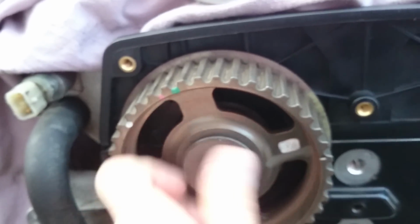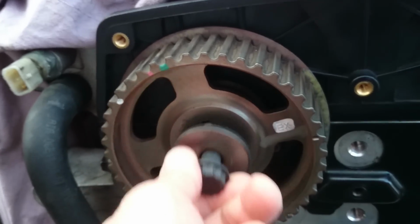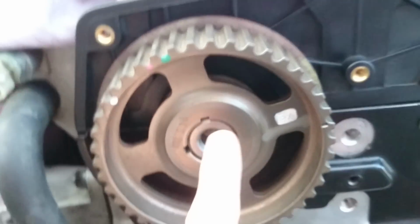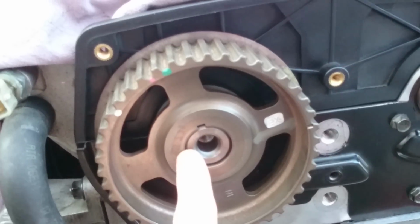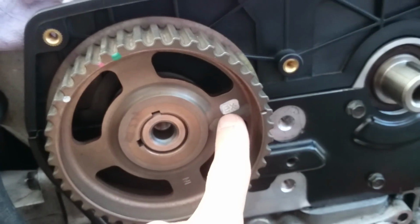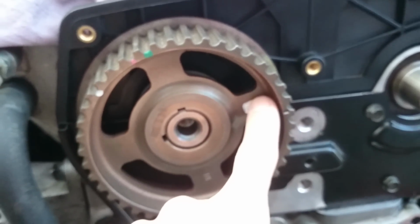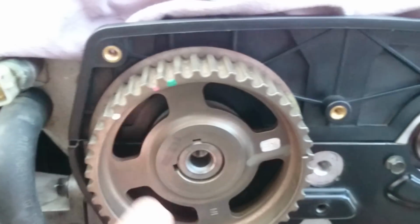And the same thing again with the rubber strap. I would suggest the rubber strap, number 17. We need to loosen and unscrew this bolt with a very solid washer. In this case, we've got two points here for the position of this wheel. So we need to remember that this one is close to the green on the top, with the position of the mark for exhaust on the right side. So when we're putting back, we don't get this 90 degrees wrong.